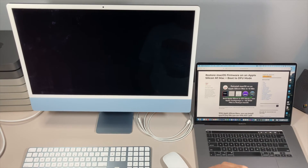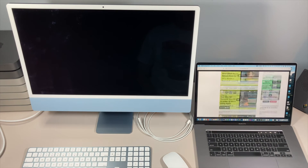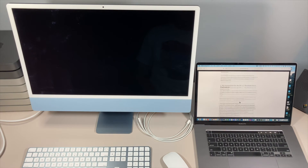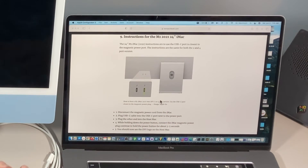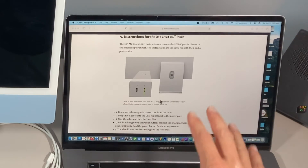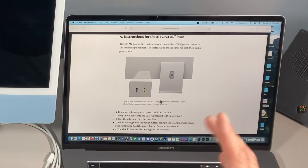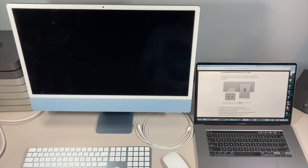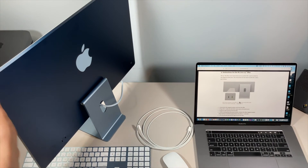That's it for the second fastest way to install macOS Big Sur on your iMac. The next thing we're going to talk about is installing macOS with Apple Configurator 2, a USB-C 3 cable, and DFU mode on the iMac. I've got my article up here — I'll include a link in the description on how to restore macOS with Apple Configurator 2 with your M1 Mac in DFU mode. The port used for the USB-C cable is the port closest to the new magnetic power adapter.